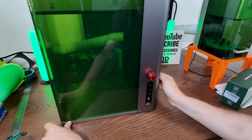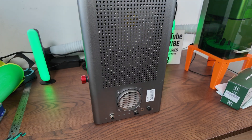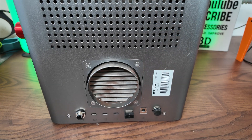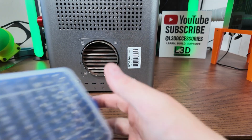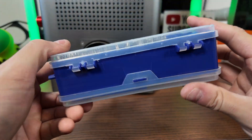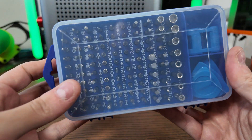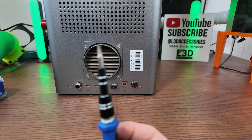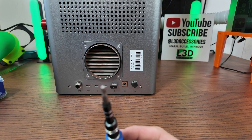I'm going to show you exactly what we're going to be doing — a little show and tell because, as you can see from mine, it's absolutely filthy. We'll be taking that out and removing these four screws. One point: if you do a lot of maintenance on your machines, you should pick yourself up one of these screw bit sets — really cheap online and they have basically every screw head you'll ever need. The bit you need for this is a 2.5 millimeter hex bit.